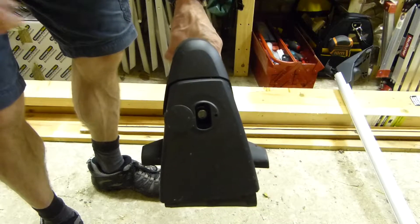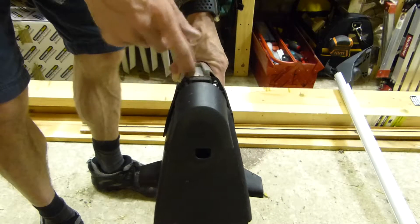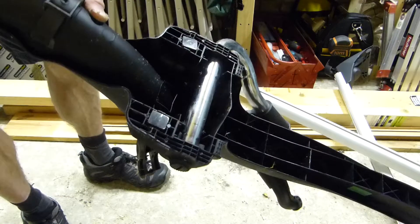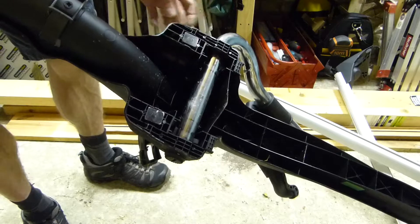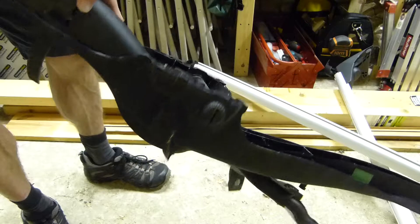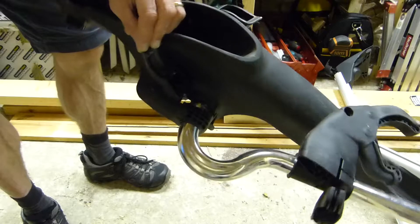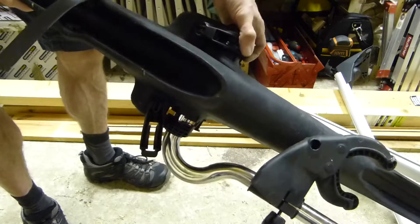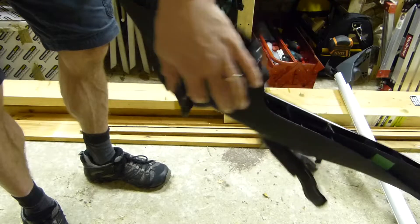When it comes to fitting the cycle carrier onto the bar, there's a little cap on the end of the bar, and you can see there's a T-shaped groove on there that the cycle carrier slots into. Into that groove slot these little square metal plates that are on the cycle carrier itself. They can jiggle around and line up — they're quite loose to start with, but they're tensioned by pushing these little clamps, one on each side, which pull the plate tight against the T-groove.